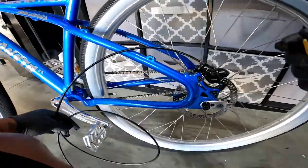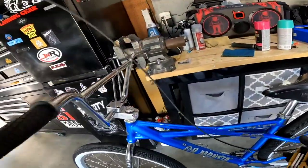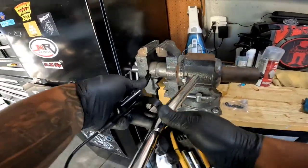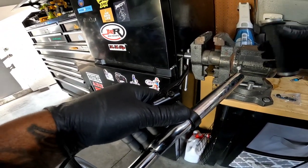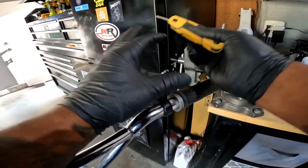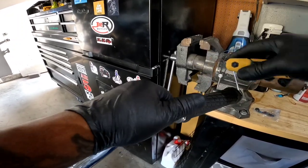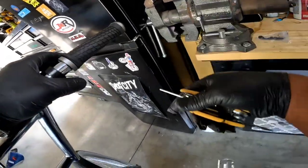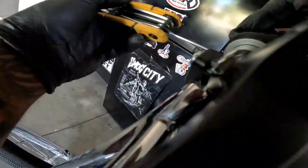Put it over your disc like so — she looks good. Don't tighten these all the way, just tighten them up a little bit. Take your line, slide your brake lever back on, slide your Troy Lee back on, make sure the words are lined up. You want the name facing forward, tighten that up. Tighten your grips up before you tighten up your lever.